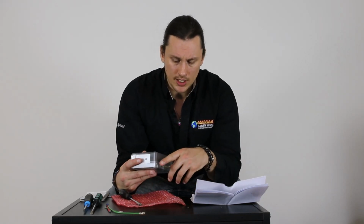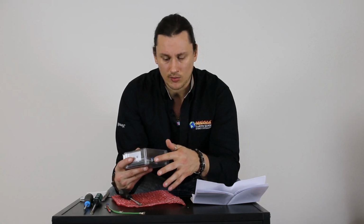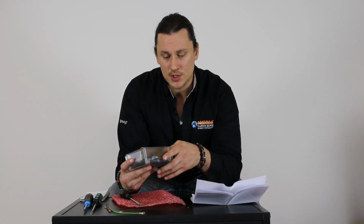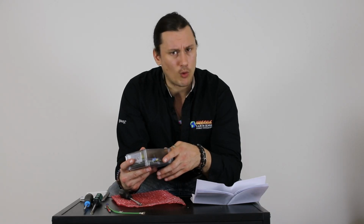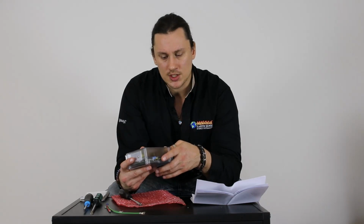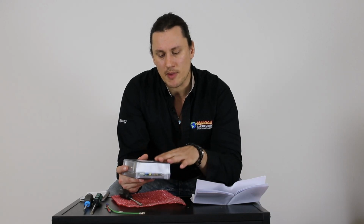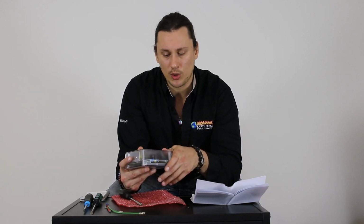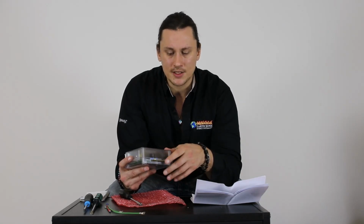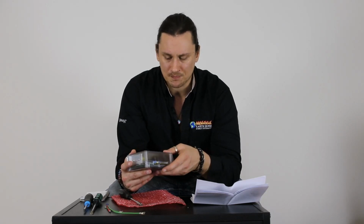It is important when installing that our main electronic sleeve here, or our receptor, our indicator on the control board, is securely plugged into the junction box. So I always tell people it's important not to force anything. This actually should go in pretty easy, but the best way to do it is just to give it a small wiggle. Pay attention to the way that the old board came out. Again, this one may look a little bit different than your existing control board, depending on the age of your stove. However, once that old board is out, we simply just want to slide this in, and as you give it a gentle wiggle back and forth, you'll feel it lock all the way down in place.